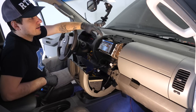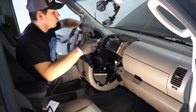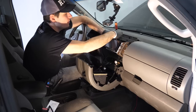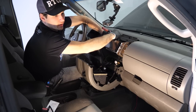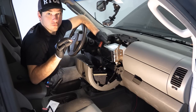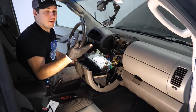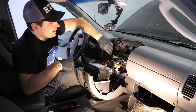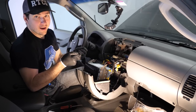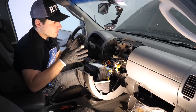I can't seem to get it running. I'm going to check the manual and see what's going on. It turns out the positive and negative cables I used were for a specific Kenwood camera, so I have to pull those off and find a different place to wire them. I already have something in mind — where I brought the cable through the firewall is right behind the fuse panel. I can slave off a particular fuse there and hook up the power, so the camera just runs whenever the car is running. All is not lost since I had to come back to plug in the video cable anyway. I'm going to pull the power cables back and supply power to the camera elsewhere.